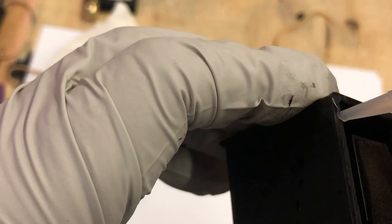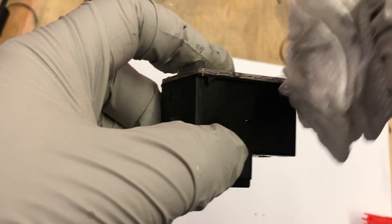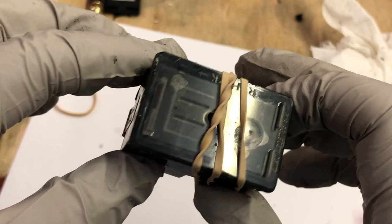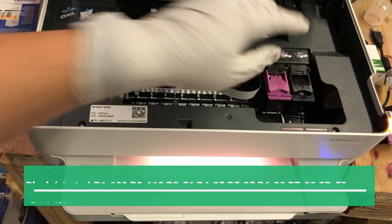I can glue it together. Please refer to the original 'how to make a spongeless cartridge' video — it's more detailed, step-by-step, and gives lots of pointers. Make sure you glue it airtight. Wipe out the excessive ink, then put the rubber bands on, and let it set for 12 to 24 hours. I use 'SP' — meaning spongeless. Let's print the first 50 pages.